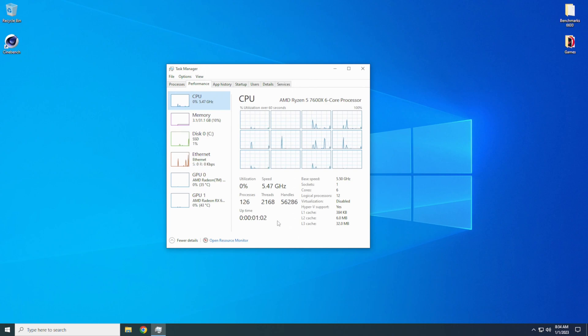You need to use the computer for a while to see if it's stable. I believe I lost the silicon lottery on this one — it booted into Windows at 5.5GHz, but as soon as I ran Cinebench R23, it crashed, meaning it's unstable. I went back into the BIOS and tried other settings, and I couldn't go above 5.2GHz on a manual overclock, while the auto overclocking ran fine up to 5.3GHz. Some CPUs are just better overclockers than others, and unfortunately I think I got a bad one for overclocking.